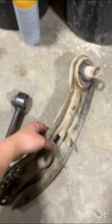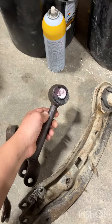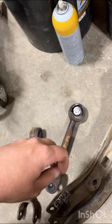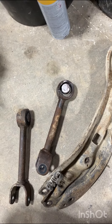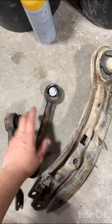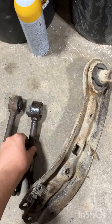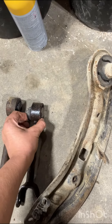With the trailing arm out of the way, I was able to get in with my sawzall, cut both sides of the lateral link, and then just knock out the bolt. Of course, I did have to replace that camber bolt — I got that straight from Dodge — on both sides. These are the lowers, so they're a bit shorter.